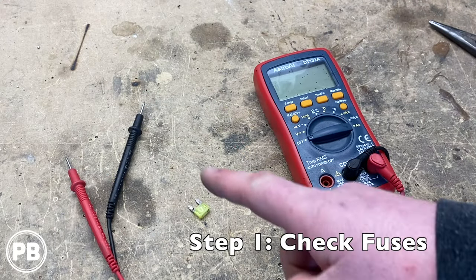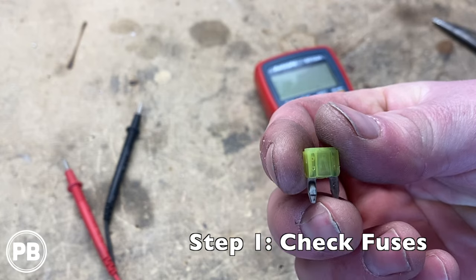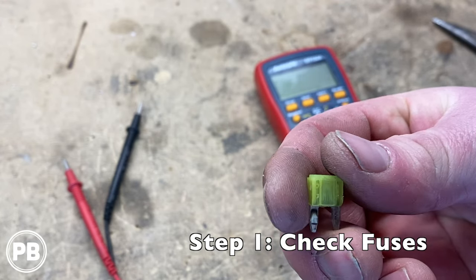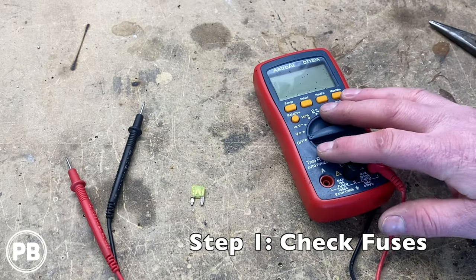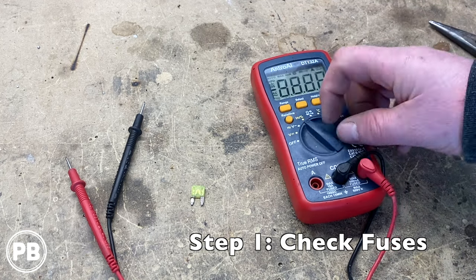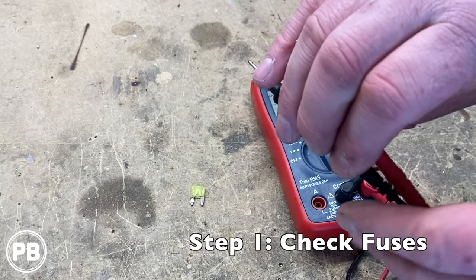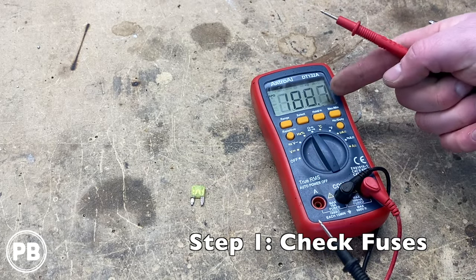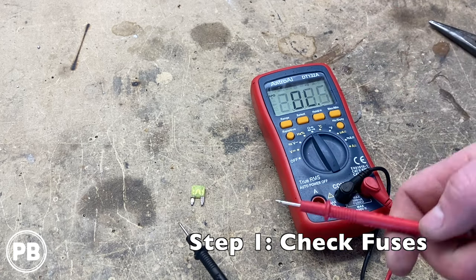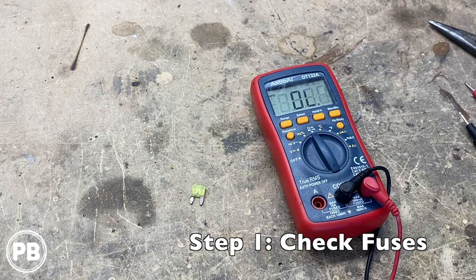Here at the bench, we have our multimeter and the fuse we're looking to test. Looking at the fuse, it does look good — we can see that little loop in there and it's not broken. However, that's still not always 100% confirmed, so we're going to test it with our multimeter. This multimeter is from our local auto parts store, and we can link one in the description. We're going to set this to our continuity tester — it's the one with the dot and the three lines. If we put the probes together, we hear a beep. So if we touch both poles of the fuse, we want to hear that beep to confirm the fuse is good. We hear it, so we know that fuse is good and it's not our culprit. Let's reinstall it and check the other one.